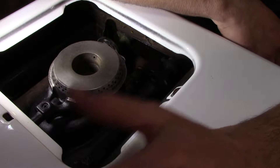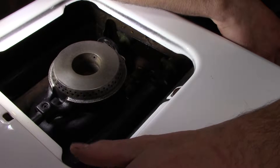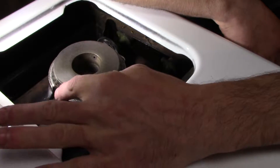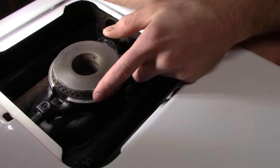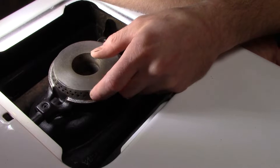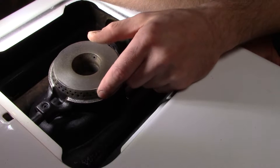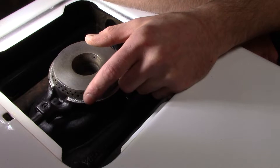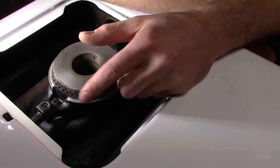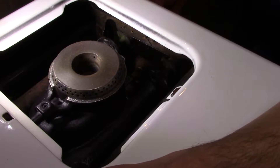This video is going to be actually really boring because I tested these burners and they're all pretty much perfect. I'm still going to show you the process I go through to get a nice consistent flame that lights reliably with the pilot. It always helps to have these burners sandblasted — all these little holes get perfectly clean. The size of the hole matters: if they're too big, you'll get a really goopy flame; if they're too small, they're going to shoot out too much and not give you a good heat pattern. Let's try this burner.